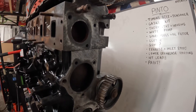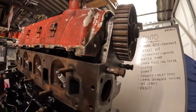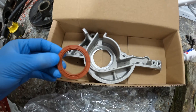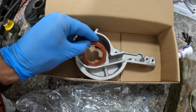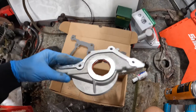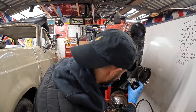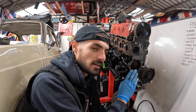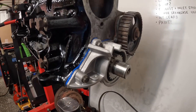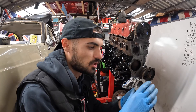I've gone over all of the surface with a wire brush and some brake cleaner - it's all nice and clean and smooth. I even managed to get behind the cam sprocket so yeah, it's all nice and clean. The first part to go on is the oil seal cover - here it is looking nice and fresh. I've taken one of my oil seals out of my bottom end oil seal kit which I also purchased, so I need to tap this in nice and straight. Oil seal is now tapped home, and I'm just going to put the gasket on with a little bit of sealant. The oil seal cover is now completely bolted up and tight - I've got a lovely slim line of blue silicone going around the top which is always satisfying to see.